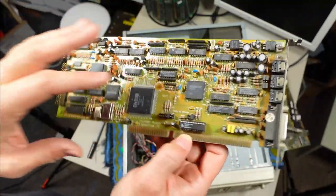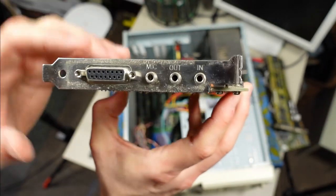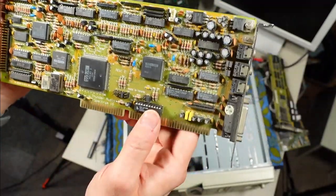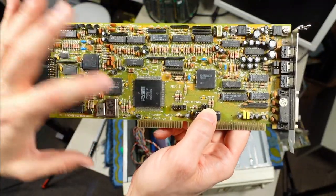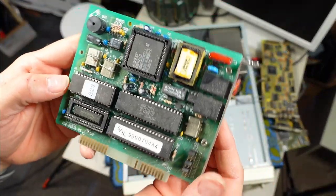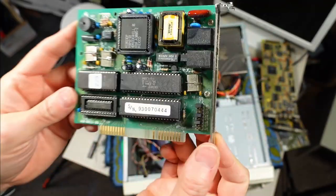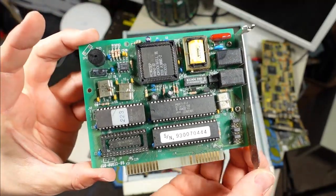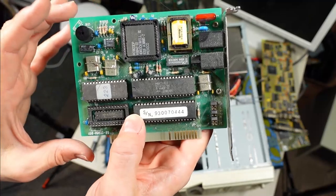It certainly has a lot of ICs on it. On the back, besides the game port, we have microphone in, out and in. This is almost surely not plug-and-play compatible — this will have manual configuration. Plug-and-play came with Windows 95, and I can see 1993 date codes on this card. The last card is the modem, and sure enough, pretty boring — it has a Rockwell chip on here. Ultimately, modems are a pretty boring thing; internal ones you can't really use right now. Serial ports are more useful.